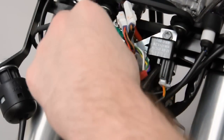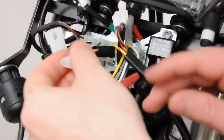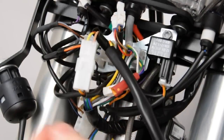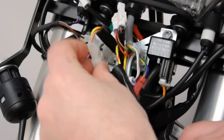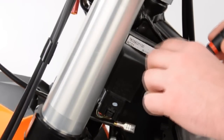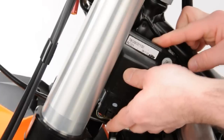This can be identified as a 2-pin Molex connector containing one brown wire and one yellow wire with a red tracer. This step is particularly important, as it will provide switched DC power to all the lighting accessories and is a key step in the installation of Trail-Tech's high output electrical system. Route the remaining red-yellow wire with spade terminal down the left side of the motor following the stock wire harness. To do so, take your 8mm socket, loosen the fasteners holding the CDI to the frame, and gently pry the CDI away from the frame, allowing for appropriate distance behind it to route the new wire.